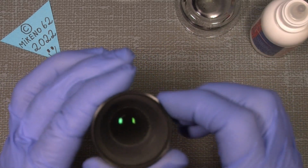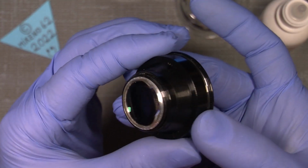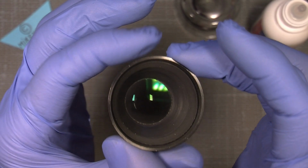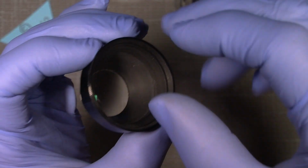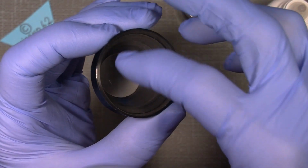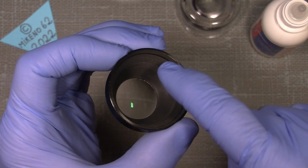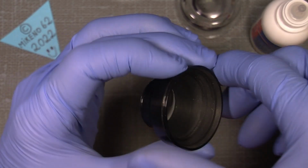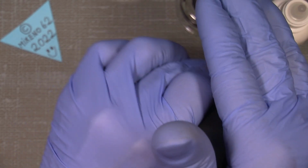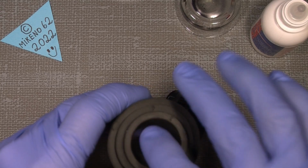So how about that? Well, as I was thinking about, okay, is it really possible to take out the front lens from its mount somewhere? No, it's not really. You can see there is a difference, it looks like a kind of a ring that if I move, I could take the whole assembly out the front. But I found out, without using a lot of force and even more lighter fluid, not lighter fluid, but isopropyl alcohol or nail polish remover, that this ring is actually just a ring that's really tight.